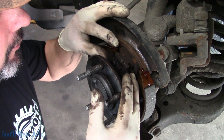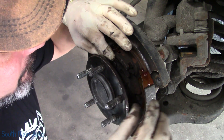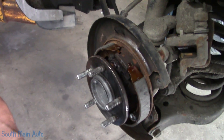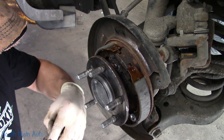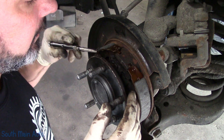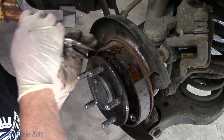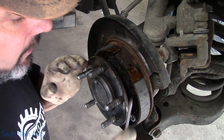What we'll do is get the actuator in. Usually I just stick it in one shoe, slide that shoe over, hold it, and then slide the other shoe over — and that's pretty much that. Then you can put your top spring back in. Hook your spring into your vice grips. There is no right side up or upside down to this spring, just this side out. Hook it over there, bring it over, slip it in the slot, and I like to come through with a screwdriver and give it a little push to make sure it's in all the way.